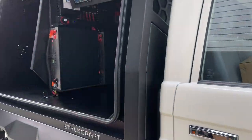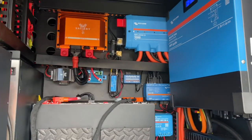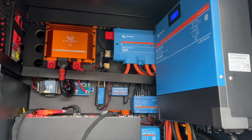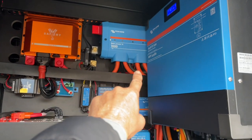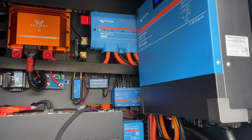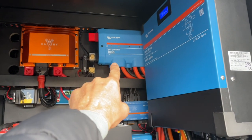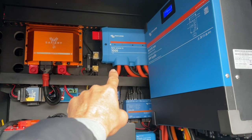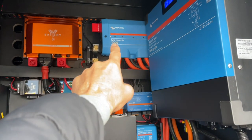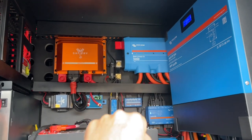And then in the back here we've got the power plant. Let me talk through the difficulty that the rear winch presents. This has got a 14,000 pound rear winch in the rear, and that distributor you see up there has got two 70mm cables coming in from the alternator — one going to Scotty and the other going off to the winch. Without having that in there, Scotty is adding 250 amps to the rear winch; without it, the rear winch wouldn't have a prayer of a chance. So you've got the alternator in the front coming in here, adding onto that a Scotty at 250 amps, and then 70mm squared going out to the winch in the rear. From here it's probably about max 3 metres and it will actually hold up.